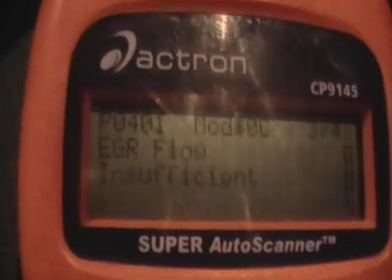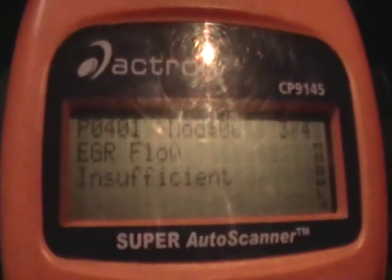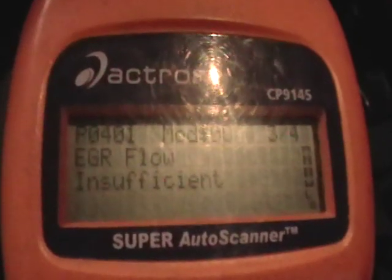From VX411, got a '98 Acura with a check engine light on. The code is P0401 EGR flow insufficient. I will show you what the problem is with these — it's a common problem on a V6 Honda and Acuras. It's not the EGR valve, it's the intake manifold. It gets clogged up. So I'll remove the intake manifold and show you where exactly it clogs up.